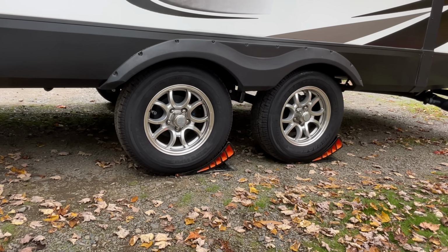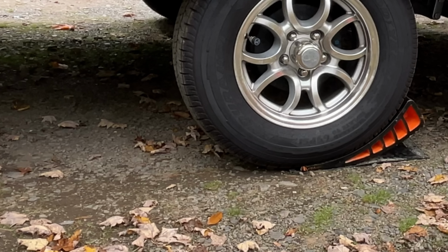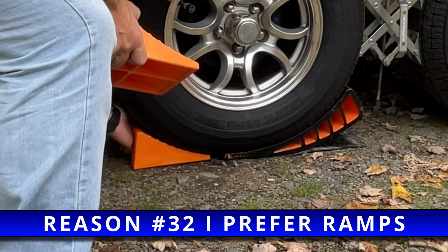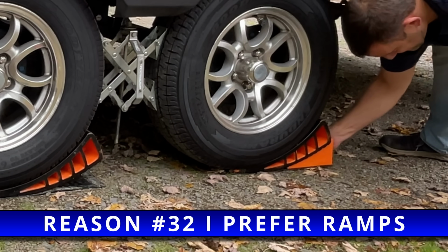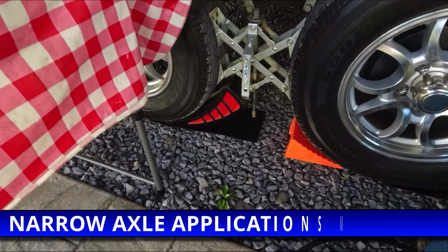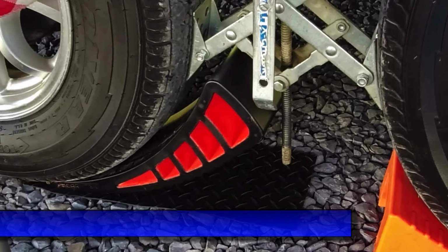If you need to go up a minimal amount like a half or 1 inch, you're going to quickly notice you won't be able to get the chock under the ramp. That's okay, you can just use the leveling chock as a standard wheel chock on the exposed side. And also, going back to my recommendation on X-Chocks, the good news is that they will fit with the Camco Tech leveling ramps, even if the majority of the leveler is positioned between the tires.